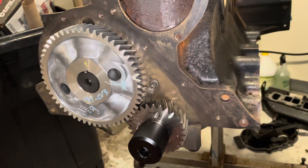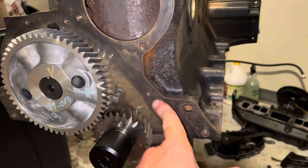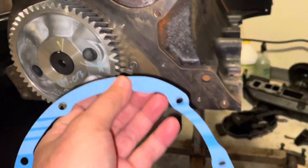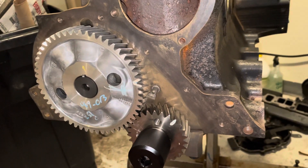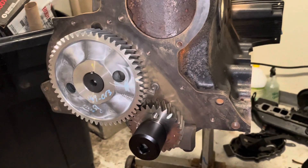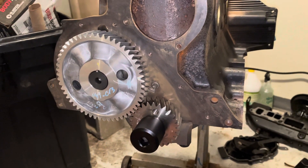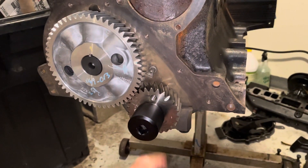So that's what I'm about to do now. First I'm going to put the ultra-gray silicone sealant around the engine, then I'm going to put the gasket on — this is the gasket here. Once the gasket's on, I'll smear sealant on the gasket itself, then I'll put the timing cover on and use this device to center it up, put the bolts in, and it'll be done. I think I've probably saved myself a good 30 minutes on the installation of this timing cover. In the next segment you'll see the timer cover on, and this tool will be in the center of the timing cover.